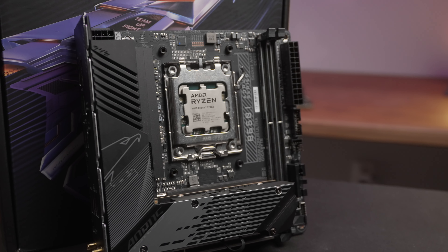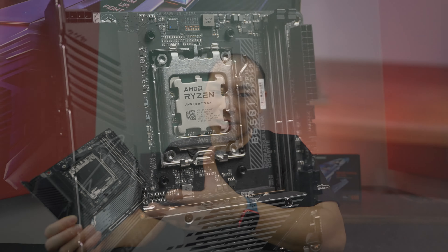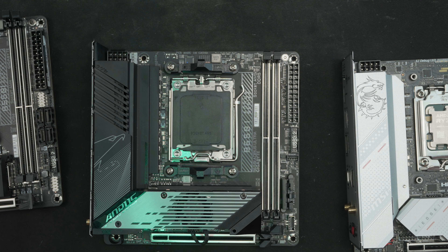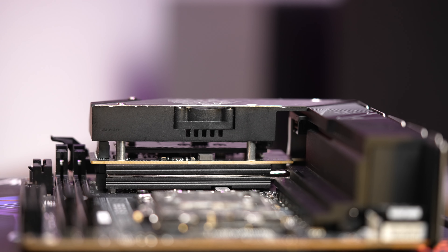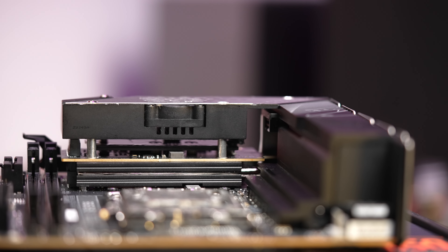There are a few design elements on this board that are complete head-scratchers, so keep watching. This board uses the B650 chipset, same as the MSI B650ITX, and that means this X16 slot is PCIe Gen 4. For how long AM5 is supposed to last and the current GPU landscape, you're going to be okay with that. What sets this apart from MSI's implementation is that B650 allows an optional Gen 5 NVMe M.2 off the CPU lanes, and Gigabyte has taken full advantage of that here — your topmost M.2 is PCIe Gen 5 compatible.